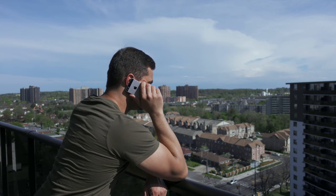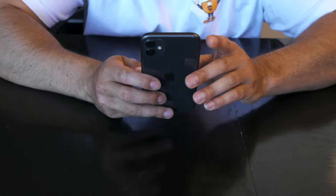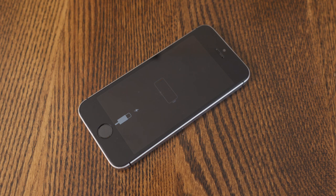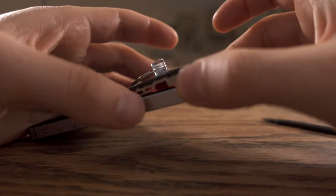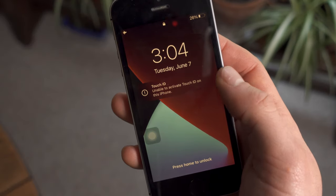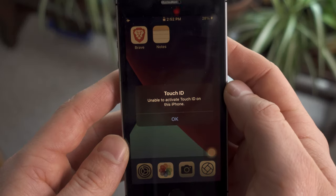To understand how this phone and this problem entered my life, I need to introduce you to my friend Curtis and my old iPhone SE. Curtis shares my love for this phone. For years, he and I used the exact same phone — same color, same 128GB of storage. While all our other friends were upgrading to newer models, he and I stuck with our first generation iPhone SEs. But as time went on, the battery in my old iPhone SE began to fail. I replaced the battery myself, but while lifting up the display glass, I accidentally tore the delicate cable that connects to the home button and fingerprint sensor. Replacing the cable does fix the home button, but the fingerprint sensor cannot be fixed — it only works with the original cable. Once that cable is broken, you lose Touch ID functionality forever.